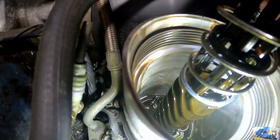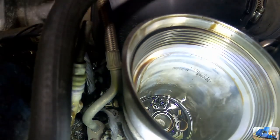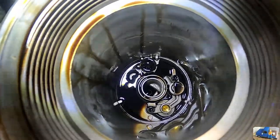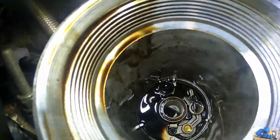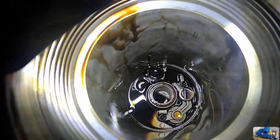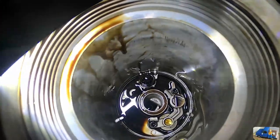We got her with a magnet. Now this guy — we just need to rotate counterclockwise, right about like that, and then lift straight up. The old gasket came out with it. That's what she looks like with the old standpipe removed. I'm going to try to put the new gasket in position down in the housing — that actually pops into a recess down there, and it has a nice little groove that it sits in. That was pretty convenient. Just make sure you don't drop it in the hole. The tube doesn't have anything that really retains it in the right spot, but that captures it down there. I did put a little bit of oil on it before I stuck it in there, so we'll drop our new one in.